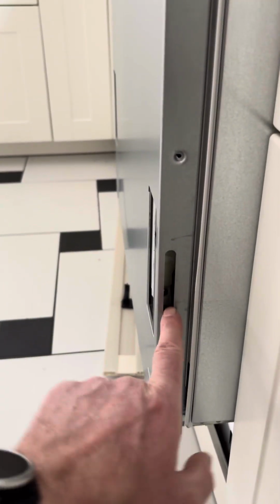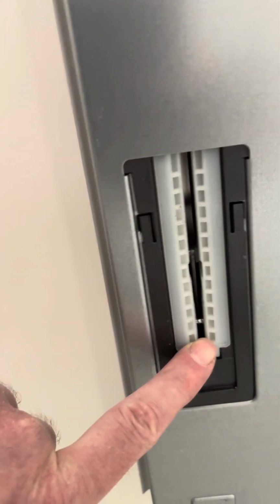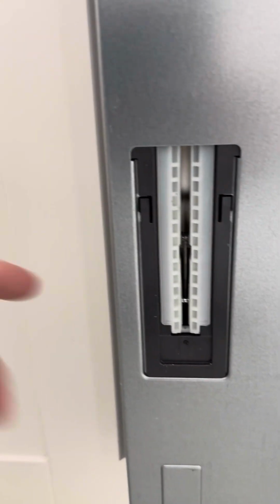And if we look at the front of the dishwasher here, there was a tip that took me a little while to figure out, which is in some ways the purpose of this video. In here is a holding screw, and that holds this hook here. And in order to get it in the first time, you have to unscrew this screw here, and there's an equivalent one on the other side. You have to unscrew that by about 1 centimeter or so, and then that hook will actually go in. You can see that in this particular case the screw is still in place, so I will need to come and back this out. I didn't know that, at least I missed it in the manual, it wasn't made clear. So there's a tip for you.